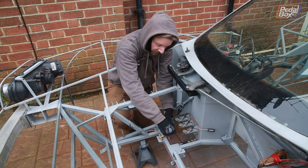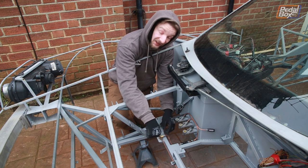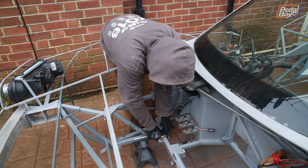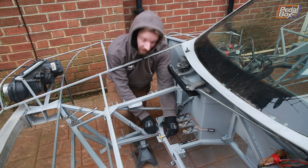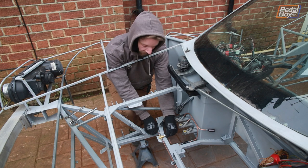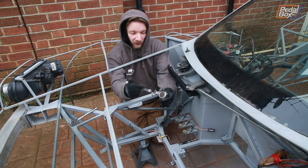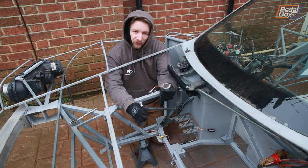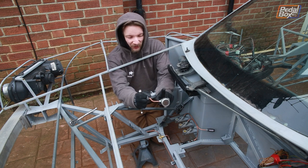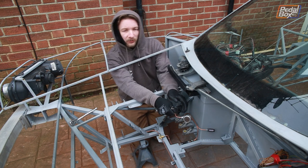It's important to remember when tightening these fittings that brass isn't really as strong as steel, so don't nip it tight and then keep going and strip one out — that really sucks. Once you're done, give all the pipes a wiggle and make sure nothing has any play in it; if you can feel them wobble freely, something's up. Finally, the clutch hose goes onto our master cylinder the same as all the brakes, and this little round thing — we have no idea what it is but it's on every single VW family car we can find — so we're just going to assume it's important and copy it. It gives us a nice little break so the pipe can bend around the pedal box and have a straight shot all the way through the tunnel.